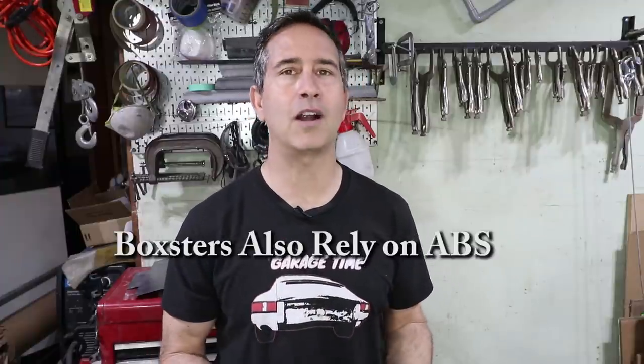So, but for my car, performance car with a lot of weight in the rear, it really needs more bias towards the rear. So that's why the dual master cylinder setup was really the key to making the Boxster brakes work. And it's also key to making these brakes work even better. It gives me that adjustability that I always wanted. So let's work on the pedal box.